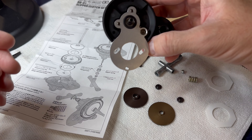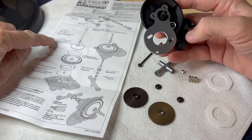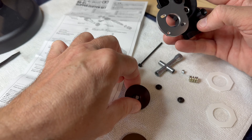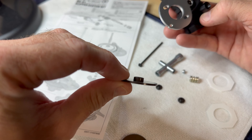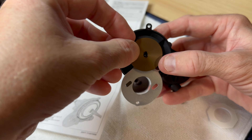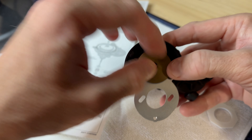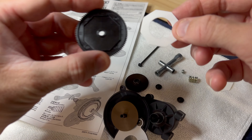I'm going to attempt to put this together on camera. We've got these pressure plates - it says 'in' and 'out'. 'In' is the first one which is thinner, and 'out' is slightly thicker, so you like the hat side of it - that goes on first. It goes on one way and locates on the pin. Now the tricky bit will be getting these little clutch pads on.